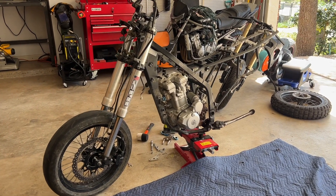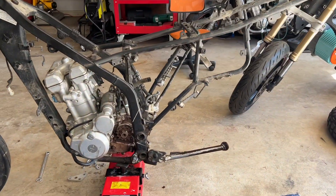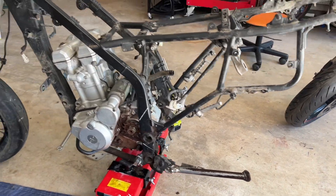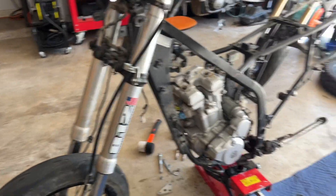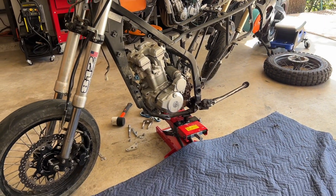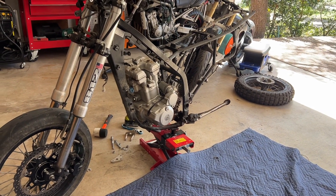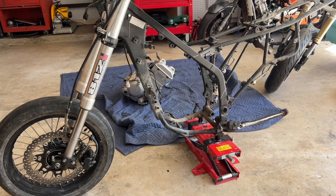Here I am on this teardown, just about ready to pull the engine out. I took the swing arm off, which had some mounts that connected to the engine, and took the handlebars off. I'm thinking once this engine is loose, I'm going to lay this down on the side and just kind of pull the frame off the engine rather than pulling the engine out of the frame. And there you have it — the engine's out, just like that.